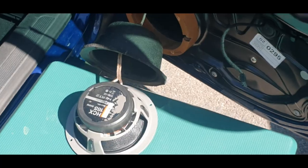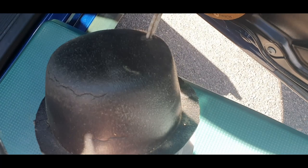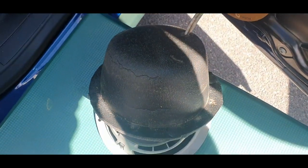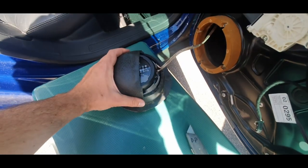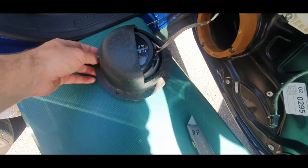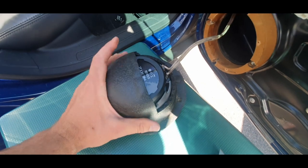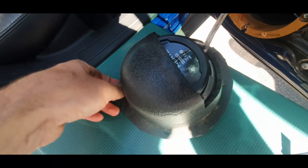Now I'm going to cut a hole with a Stanley knife in the back of the baffle. I'm not sure how big to do it — I might just slice off half the cup or about a third, so it should let a bit more airflow through. I've left the main rim around the speaker so it's still got a nice seal against the MDF, then cut a little half-moon shape so the speaker can breathe a bit more and hopefully the sound will be better.